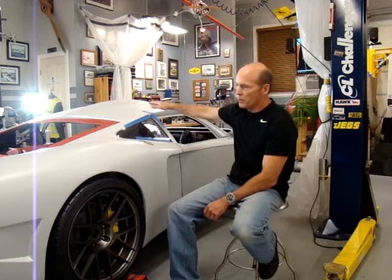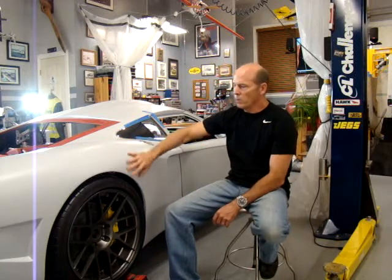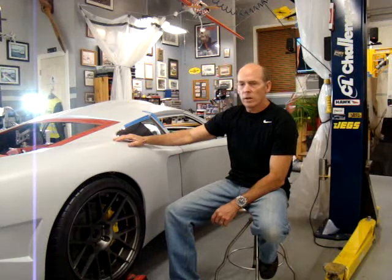The book will tell you to get the body to 100% in terms of the body work, blending all the bond lines, the roof scoop and the front of the car up where the vents are, and getting all that stuff done, and then rounding the corners and the radiuses and all that, and then take the body to the paint shop.